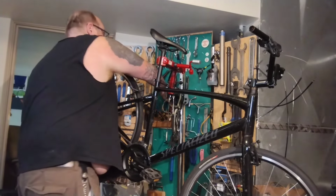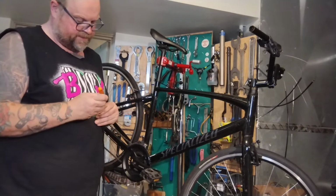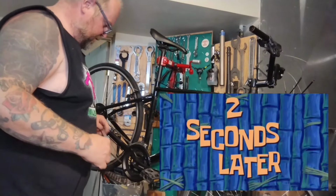I'm going to take a pokey tool, make sure this little sleeve's open, make sure there's no big burrs. I'm going to take it to the bench grinder real quick and go boop, boop, boop. Make sure these are real flush. All right, these guys are flush.